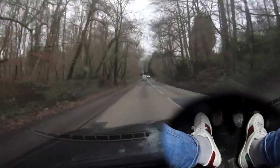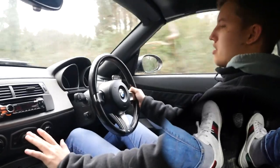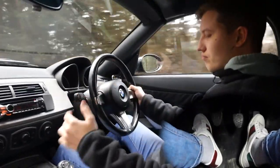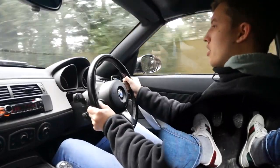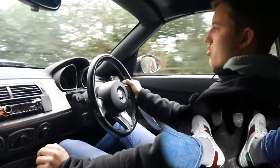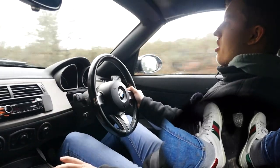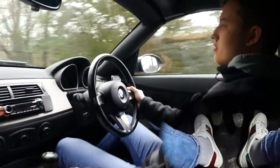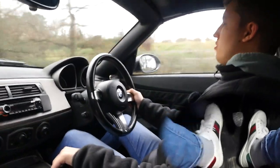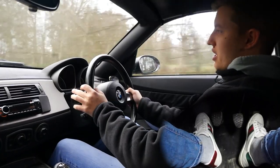So here, I'm in third gear at 40 miles an hour. If I want to go into second, I know it's going to be around four and a half thousand RPM. I just blip the throttle there and we're at the right rev range. You can try this without braking, which is extremely useful. Going back into fourth and then third — all you're doing is, while having the clutch depressed, you're blipping the throttle and building the revs up to that right level.